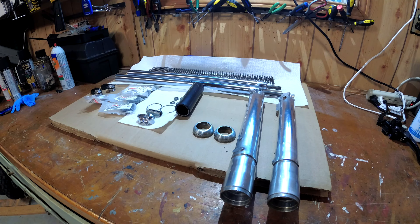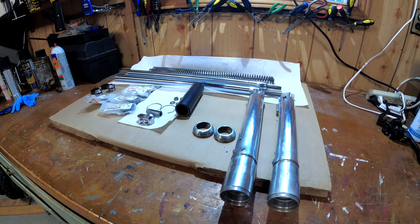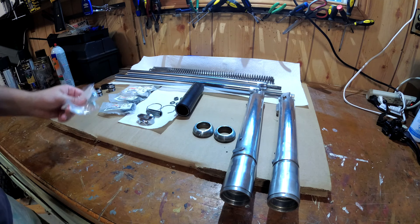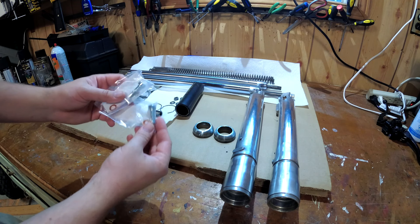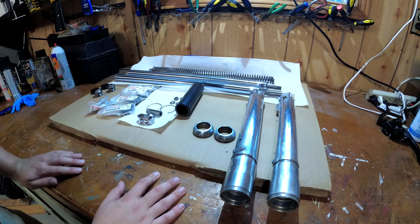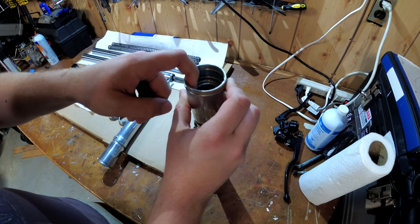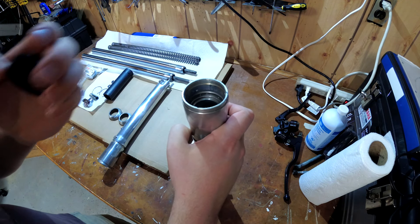Let's clean all the parts up — use some brake cleaner, clean the tubes, clean the springs, clean the lowers, clean everything, and reassemble. All the parts are finally clean. I've polished the fork lowers, even though I'll probably do it again because they're going to get a bit dirty during reassembly. I have all the replacement components. I ordered two of the fork lower bolts because I figured the other one was on its way out as well — might as well replace both. I did deburr some of the burrs on the inside of the surface because the previous owner did some funky stuff. Hopefully it goes in okay.